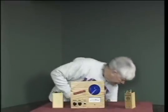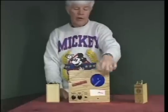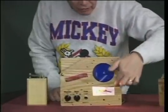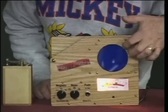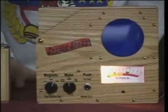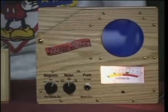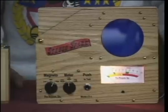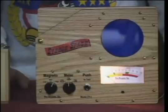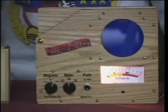I'm going to plug in the StroboSpark now. It runs on a small module that plugs into the wall. You can see it will light up, and if the camera is able to pick it up, you should see a little wheel up here spinning around with a little pointer on it — that's the strobo wheel, the spark wheel. It's just like a hand-crank coil tester in that there's a high-voltage ring behind the panel that the coil feeds high voltage to, and it will spark to the pointer. The StroboSpark is different from a hand-crank tester because it's spinning much faster — operating the coil at 450 RPM, much faster than you can crank. I have had coils that seemed fine on a hand-crank tester but wouldn't run right in the car, and on the StroboSpark they turned out to be double sparking — it just wasn't visible at slower speed.